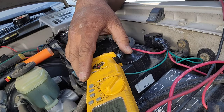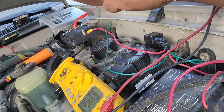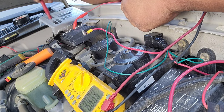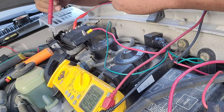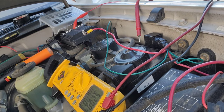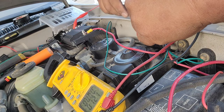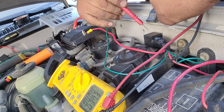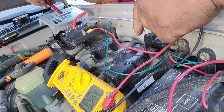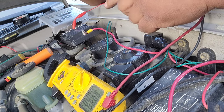So here's my multimeter. You can see the readings — the engine's off, I'm touching here, and there's no electricity pushing through to the ground. So that's off. Now I'm going to turn on the key. Once I turn on the key, that should signal the relay to bridge the gap, which sends electricity from the battery to here. And there's 12 volts — so that works.